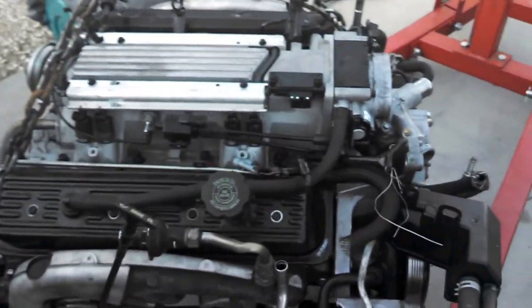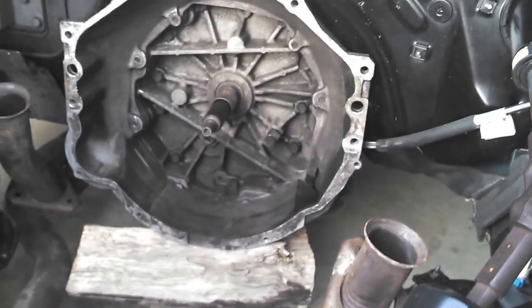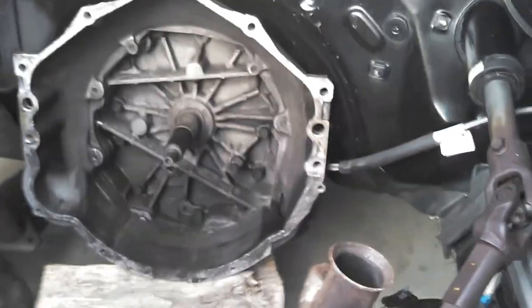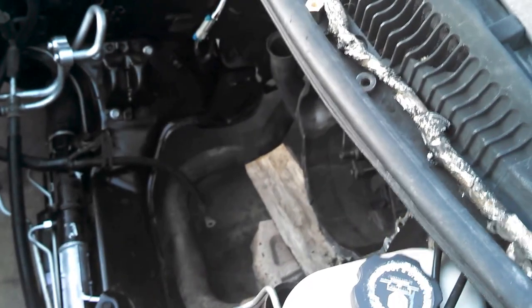Got her sitting right there, just ready to get plugged in. I also got the clutch fork from GM that came in, so I'm going to put that in before I start putting the engine in, because otherwise I won't be able to get to it. This is the engine compartment — nice and clean. I have a couple wires I have to do some soldering work on. When I pulled the motor, I snagged the oil level sensor, so I'm going to solder those back together. But I want to get the motor in before it gets dark. See you on the next video.